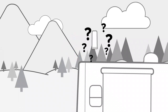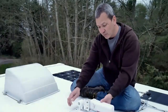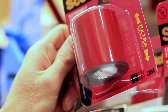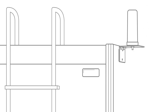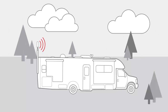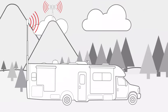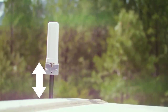If your RV does not have a ladder, pole, or vent pipe on the roof, you'll need to create a mounting point for your antenna. We've got links in the description showing examples of how other RVers have installed their antennas. A simple L-bracket and VHB tape found at nearly any hardware store will allow you to mount the antenna in a number of ways — you can mount an L-bracket to the side of your RV above the roofline with VHB tape, or mount the included antenna bracket to the side of an AC unit using VHB tape. Another trick is to mount the antenna on a telescoping pole: the antenna stays below the max height limit while traveling, but when you arrive at your location, you can extend the pole to get the antenna high into the air. However you install the outside antenna, ensure it is above the roofline and above any obstructions like AC units and ceiling vents.